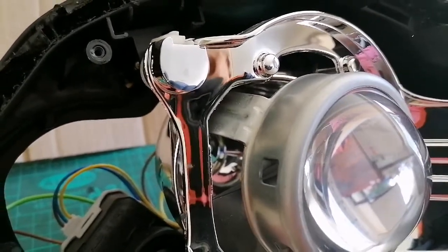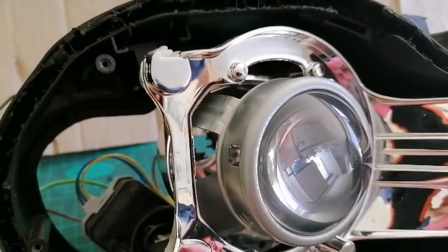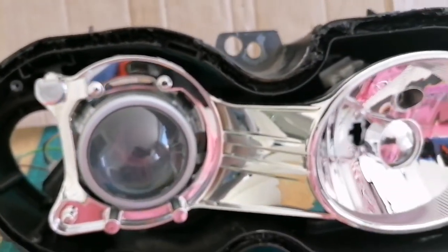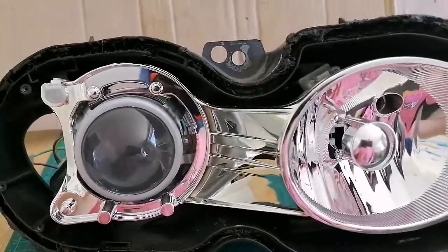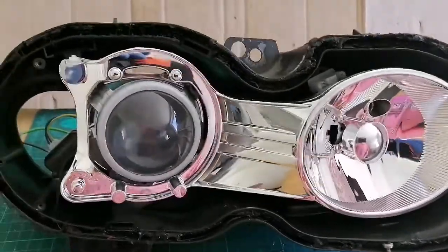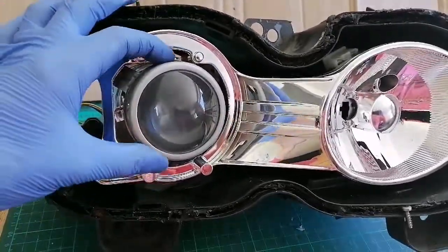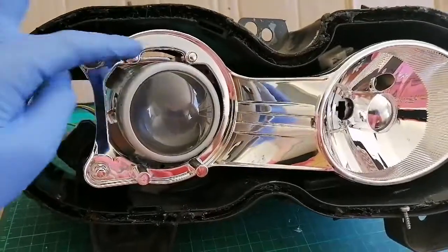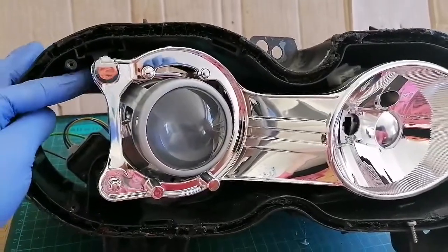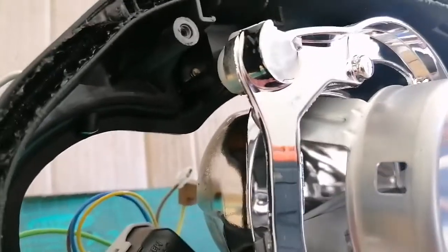It's important to make sure that there aren't any moving parts within the headlight. I send all of my headlights out with retainer systems in place, so it's very unlikely to happen in transit. But if you've bought headlights off someone who doesn't do that, it could happen. If there's any movement within the projector itself, that would indicate a broken frame - that's a bit more of a concern. But if there's no movement and it's literally just come off the runner at the top, that little adjuster screw, then that is how you put it back together again.